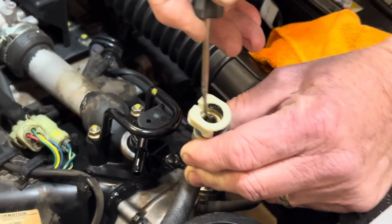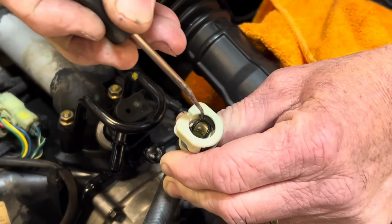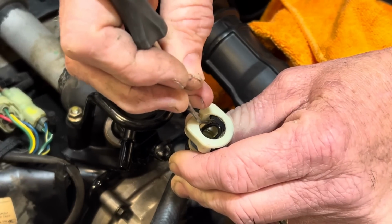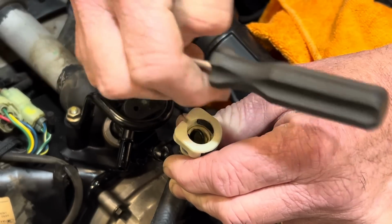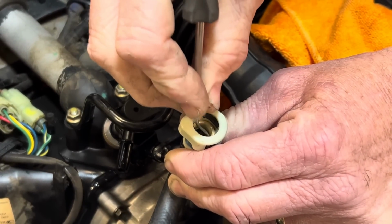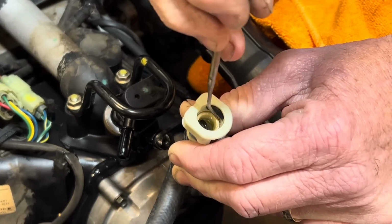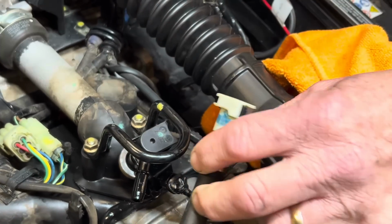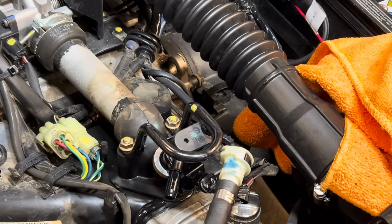This is the first one I've seen leaking like this. You ever seen one leaking, Travis? No, sir. This could have been where somebody put it in, cut it. One little cut, and all this pressure in the gas car with now the EFI, the fuel injection, with the pressure it has now, it's going to find the weakest link. It ain't like a carburetor cart with a vacuum pump. This is actually fuel pump pressure like a car has.